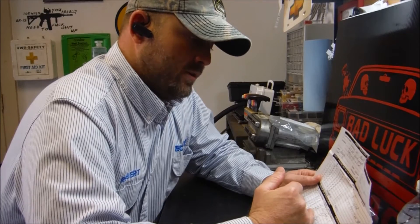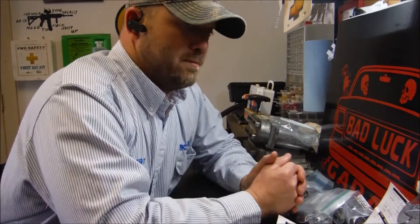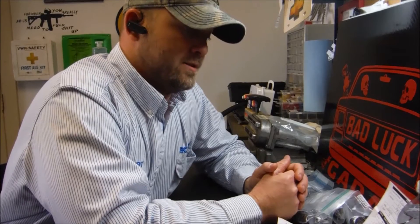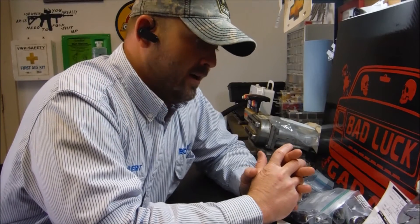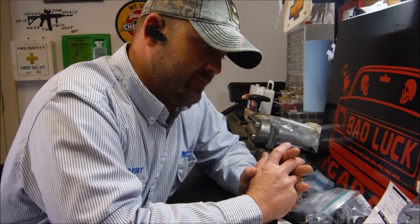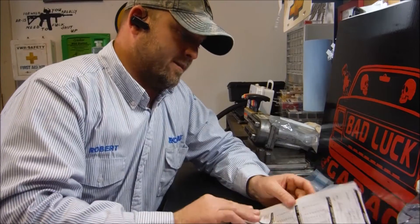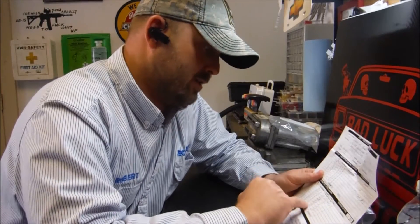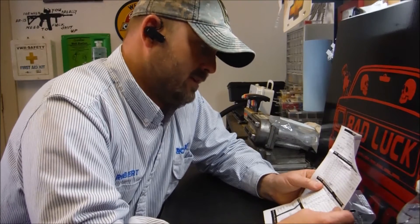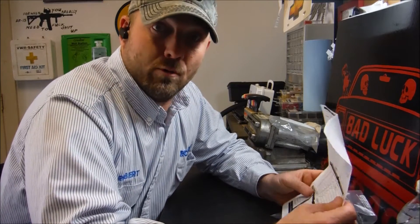This one that's flowing 67 — I'm cool with that, because I've always heard that cylinder seven on these LS engines tends to run lean. So what I was going to do is throw that in cylinder seven and let it run a little rich. The problem is I've got one that's way lower than the rest. On dynamic flow rate it was 59 and our median is around 63. So that's not good — I don't know how to deal with one like that.